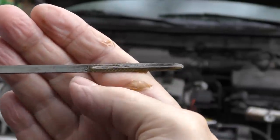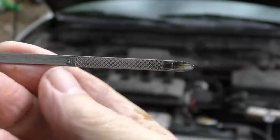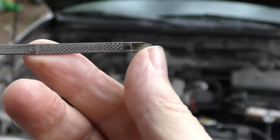Some modern cars have tricky dipsticks. Here's an older one — it's on the full line. Wipe it off and you can see the full and half marks. This range represents about a quart of oil. Some modern dipsticks are made of plastic and break easily. Heed this warning: I had a customer whose dipstick broke, they went to an auto parts store and got a dipstick they thought was the right one — it was the wrong one. They went by that dipstick, put way too much oil in, the engine hydro-locked and was destroyed. Go to the dealer and get the actual correct dipstick if yours is broken.